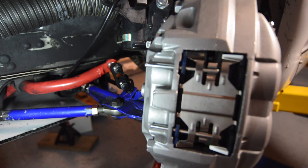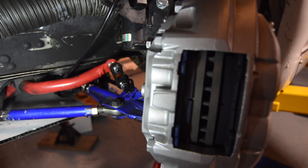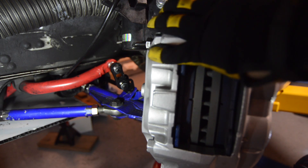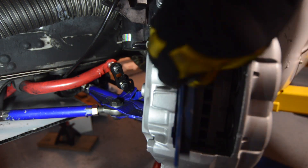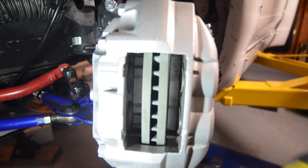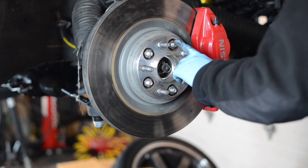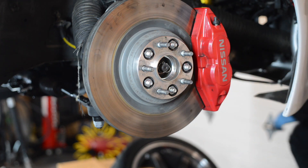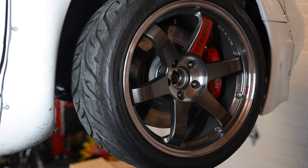We didn't film the install process of the brake lines as that's just the removal process but backwards. Please note that you still need to bleed your brakes after upgrading, and you will need a shorter banjo bolt for these calipers. After tightening up all the bolts including the lug nuts on the rotor, I double-checked the clearance on the caliper pads and made sure the rotor was set in line. Here are some shots of the front brake setup — we ended up powder coating the calipers red. Excuse that the brakes are a little bit dirty, this was after a few track days. There are also shots of the brakes with some CE28s and TE37s. The next video we're going to be installing the rear 370Z brakes on our S13.